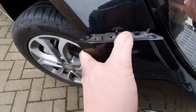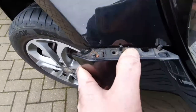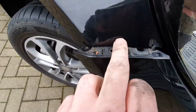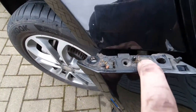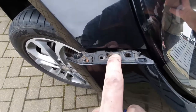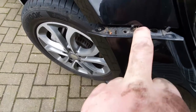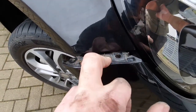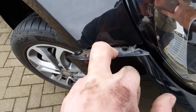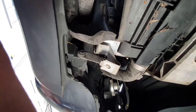To release the bumper, all you're going to do is pull down on this bit of the bumper — pull down and away — because you've got to be careful with these two positioning lugs on the top. If you were to just pull forward without pulling down first, there's a chance you might break them. What I'd also suggest — which I haven't done — is put some decorator's tape along the top panel just to protect it whilst you're installing.